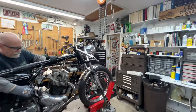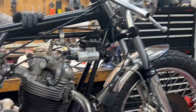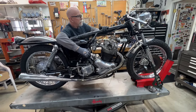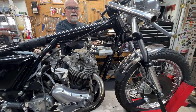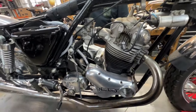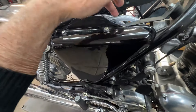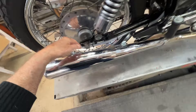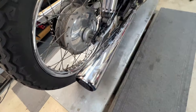We've made some serious progress. It's about 10:30 to 10:40 — that's pretty good. The whole electrical system is working, including the horn — a little meep meep horn. While Kevin's been working on that side of the bike, I've been working over here. I've replaced this vent going up to the oil tank, and this vent that comes off the oil tank, and I route it down along the swing arm and point it so that it blows the vapors away from the rear wheel rather than down onto it.